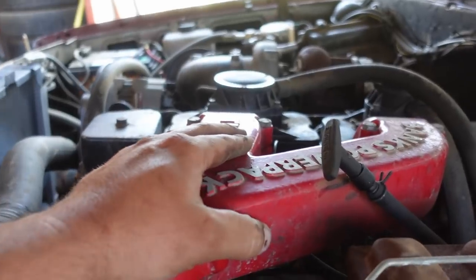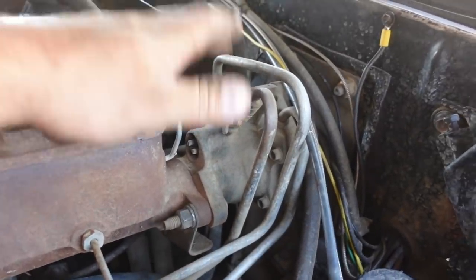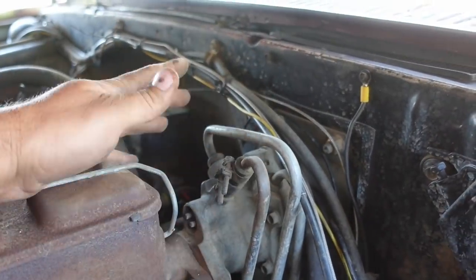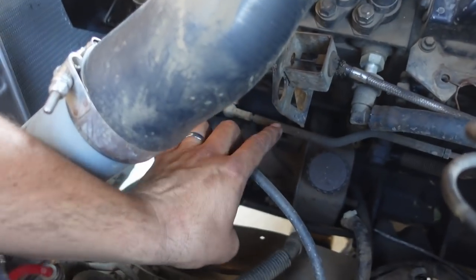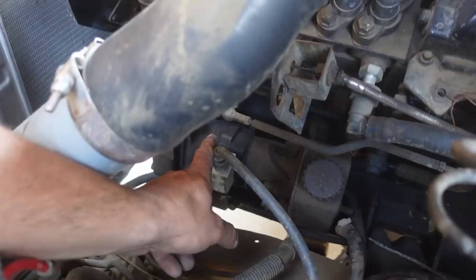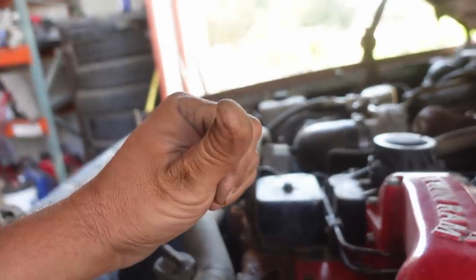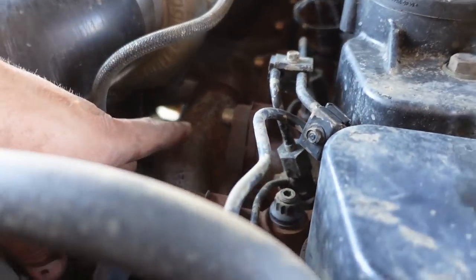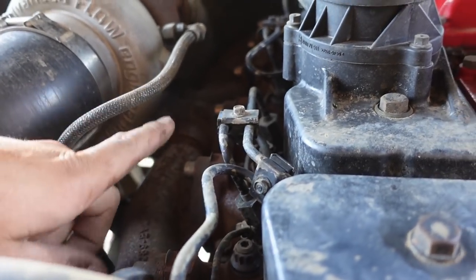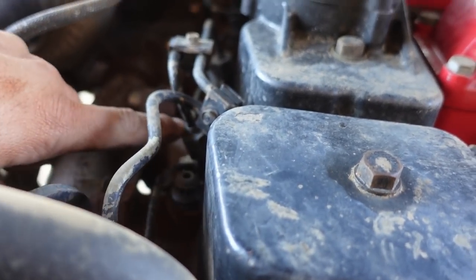It's got the Banks twin ram - I know a lot of people will say it doesn't add horsepower, but I think it looks cool. I did put the Hydro Boost Brake Kit on this truck, which is what the K30s had - it's a little bit more heavy-duty, it's not vacuum-assisted. Because of that, I had to put on a different power steering pump with increased output to accommodate the Hydro Boost Brake system. The head was ported and polished by yours truly. It's got a three-piece manifold - I think it's made by BD Power - with the T4 outlet, much larger than the T3. I don't remember what size injectors - I think they're stage three. They're big.